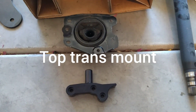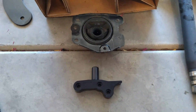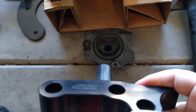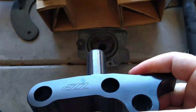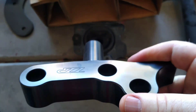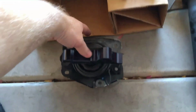At the top of the transmission there is a transmission mount and you're going to have to drill that out so you can put the new one in. You could possibly machine your own — we did it on our last transmission using a mount from a Buick Grand Sport as a template. But this one's from ZZP, which makes it a lot easier. Their kit is ready to purchase and it just fits right in there, works just like a champ.